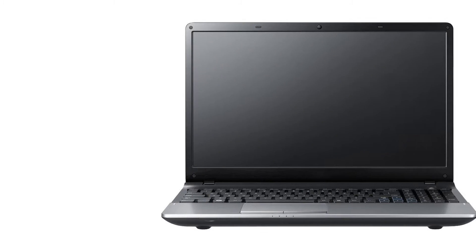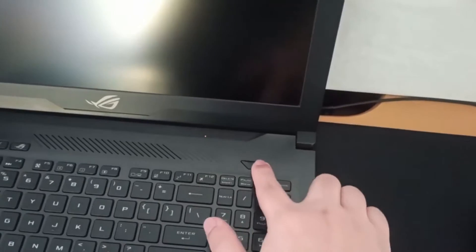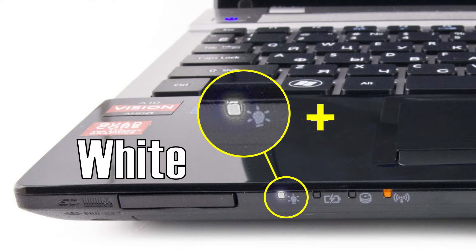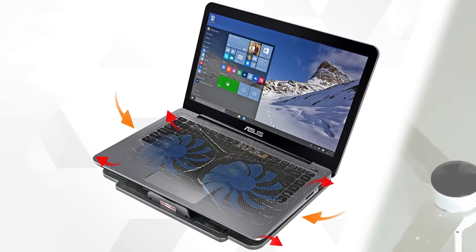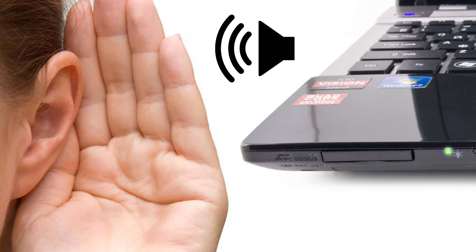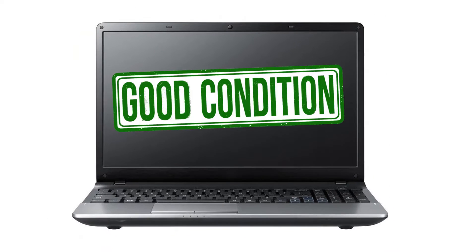Number 2: what happens if your laptop screen displays nothing but the LED indicators are fine? Just press the power button — when any of the green, blue, or white light along with the orange LED light will light up, you should hear the fan run normally. Wait for a couple of minutes and listen for a login sound or any sound you can hear. Either a ding or a dang indicates your laptop is fine.